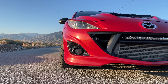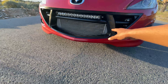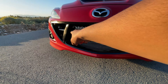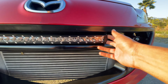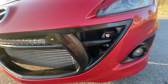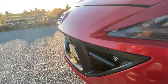Now we're gonna move to the front of the car where there's even more goodies. Up front we have a Basin R open mouth grille, along with a custom crash bar fitted to the factory mounting points. Also fitted is a mounted LED bar on tabs on top of the crash bar. We had to trim the grille a little bit to fit the crash bar behind it.